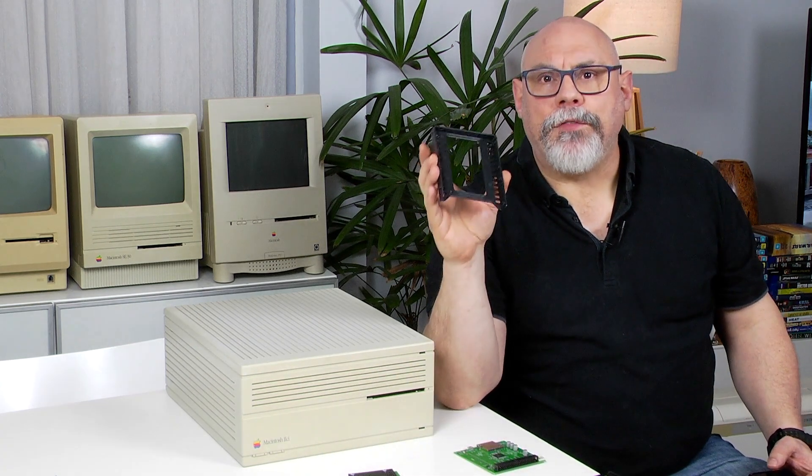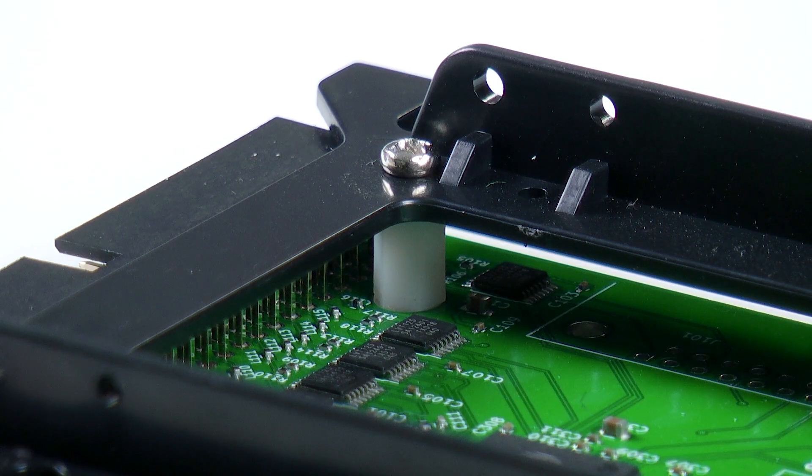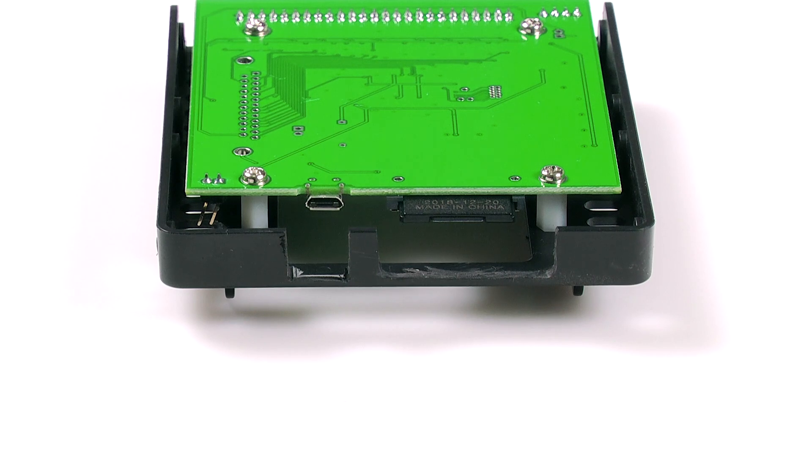One of the things I don't like about the version 6 is the size. If you're using it to replace a three and a half inch SCSI drive, the mounting holes on the board aren't in the right position to attach it directly to a Mac mounting bracket. This means it's necessary to use a two and a half inch to three and a half inch mounting bracket. Codesource do sell a mounting bracket but I picked up a cheap one on eBay for a couple of dollars and using some standoffs I've securely mounted the drive to the bracket. The only issue is the back of the bracket covers the SD card and USB slots, so I've used a Dremel to cut a gap in the plastic. It's not perfect but it works.